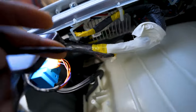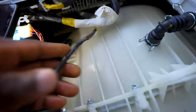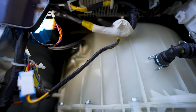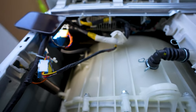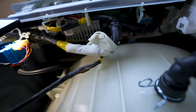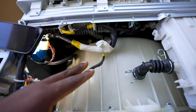Upon turning it around, you can see there's actual damage to it — that will be an issue. And guess where this goes? It goes to that switch we were just testing. Something this simple can cause the washer's door not to register closure. What you need to do is fix this wiring. I'd splice it and fix all this exposed wiring — some of it has barely anything left on it. On washing machines this is what happens: wires just bounce and rub against surfaces as the drum spins. Fix that wiring and your washer should work.